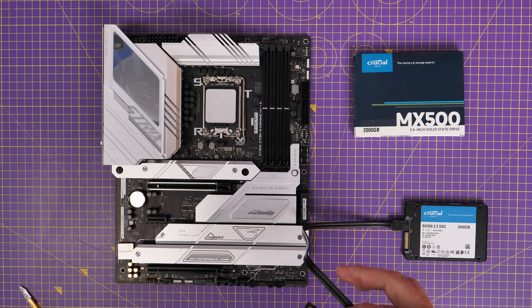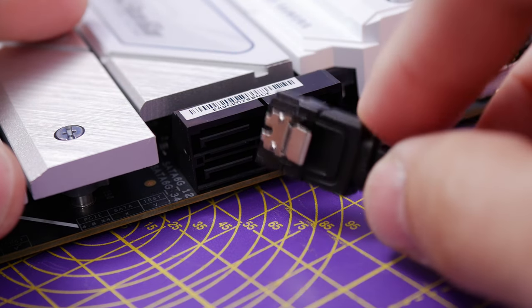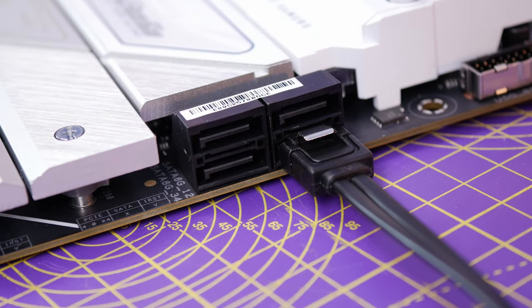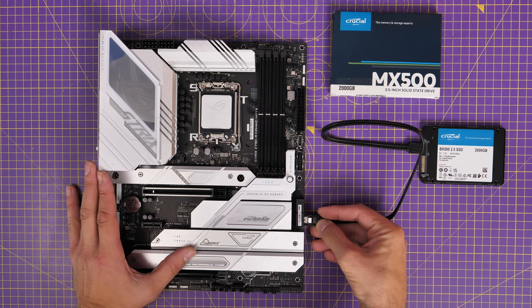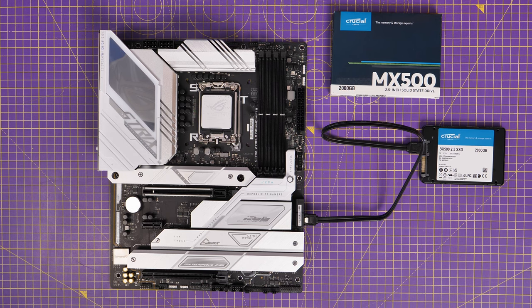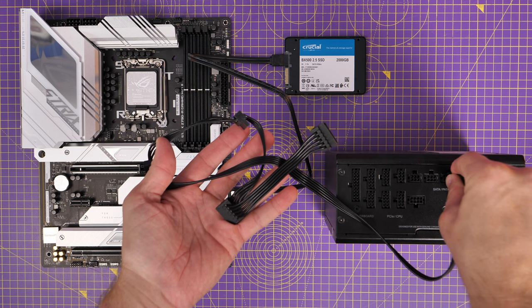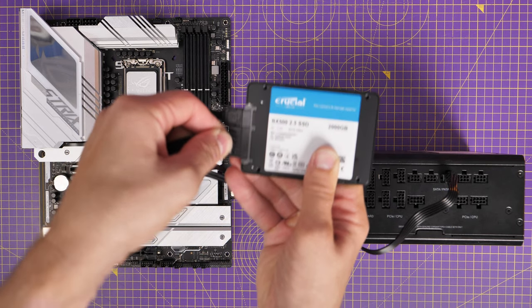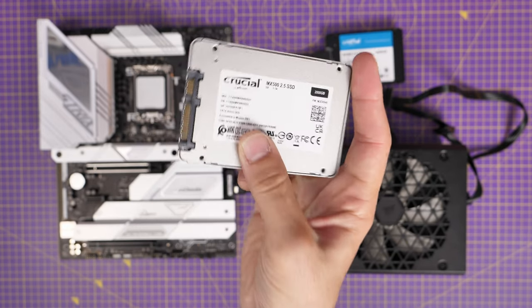There are four SATA connectors on this motherboard. It's worth noting that on some motherboards, populating an NVMe port disables one of the SATA connections — I've seen this historically on older boards. If your drive isn't working, that might be why. For SATA power you use that flat connector from the PSU — plug it into the SSD and into the power supply unit. This SATA power cable can serve multiple drives and even RGB controllers — I can connect both SSDs and power them both from one SATA power connection, but each drive still needs its own separate data cable.